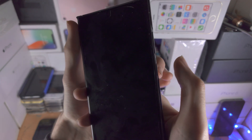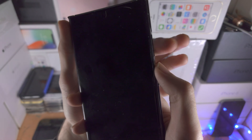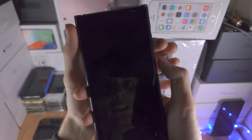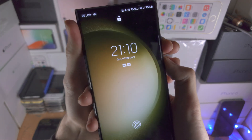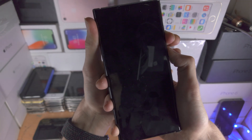In order to do this, you need to press and hold both the power button and the volume down key. Press and hold these two with two fingers at the same time. Click and hold these two buttons and keep them held down — do not release until you see the Samsung logo.